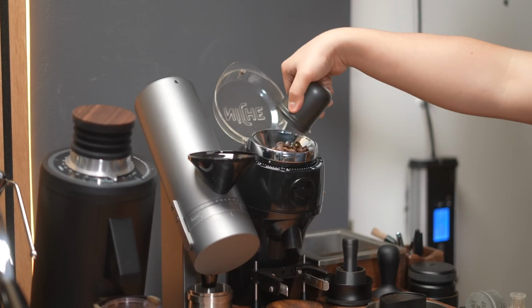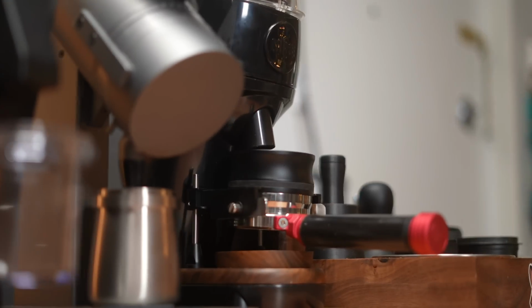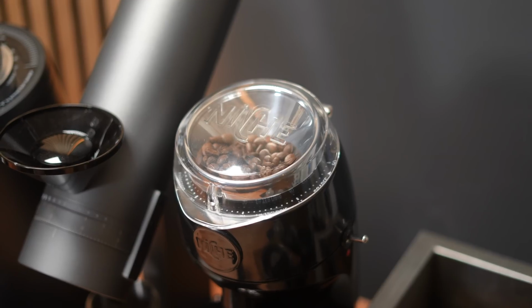Okay, so first let's talk about some of the actual performance of the newly modded grinder. Retention here remains good. After some bellowing and or smacking the top like I usually would, I was often getting exactly what I put in, or at least within 0.1 to 0.2 grams within that range. Now, initially grinding for espresso seemed to feel longer than what I was used to with the conical burrs, but the difference actually wasn't all that much, and it still took roughly 30 to 40 seconds for an 18-gram dose at an espresso fine grind.